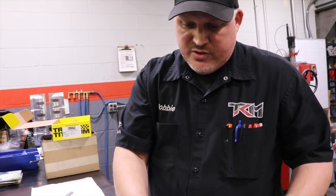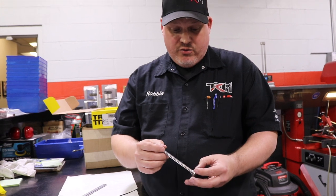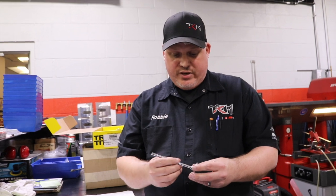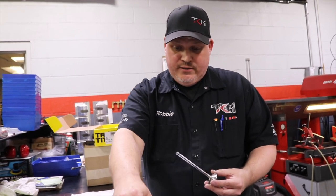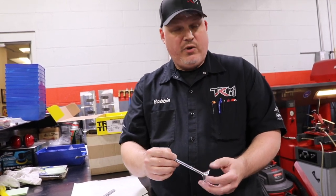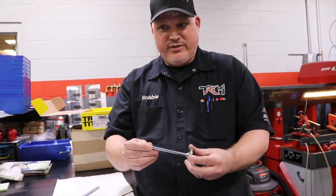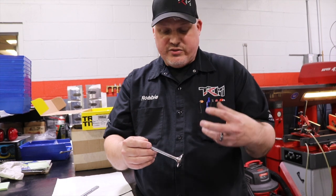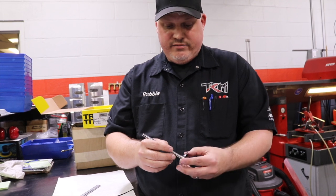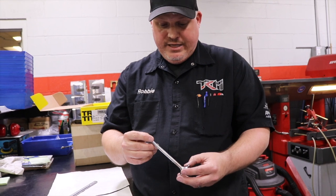As far as exhaust valves, same thing, material wise. In a turbo world, because like I said, we're 90% turbo, we try to either run a titanium valve in an M1 situation, or we're going to run an Inconel valve like this one here if we have to run race gas in a turbo motor. You can't run titanium because the exhaust valve will melt in a race gas situation with a turbo because of the heat that it generates. Inconel can withstand loads and loads of heat, and that's what we got.